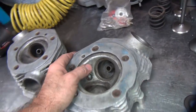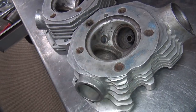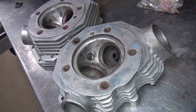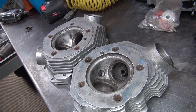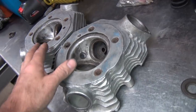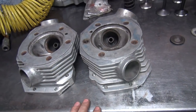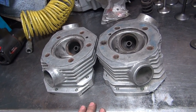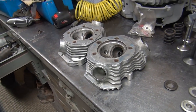The S&S carb will seal against it but it's slightly different. Anyway, I can port these things out on either one of these and match them up to the intakes so you get a package deal where everything lines up. Depending on what stroke you're going to use - this manifold is plus 200, this one's stock length. So we can figure out what kind of cams I'm going to put in this thing - I can run a mid-range cam, high-end cam, or race cam. For being a big motor set up for big bore cylinders with valves all sunk, it's probably going to get something like an Andrews B grind or a Crane - about 256-258 duration, close to 500 lift. So these heads are set up for that. Let me know what you want and we'll do it and show you how to do it all, and then they'll be for sale. Just a matter of what parts we put in there - the less good stuff that goes in it, the cheaper they are. Anyway, that's where we're at for now, so let me know, leave comments.